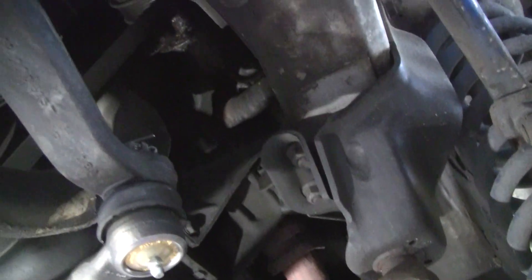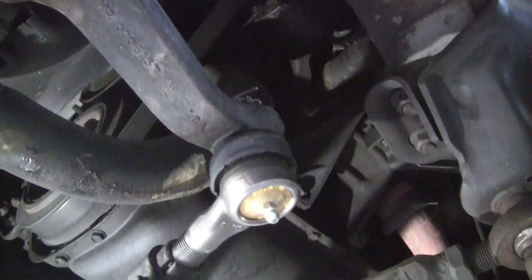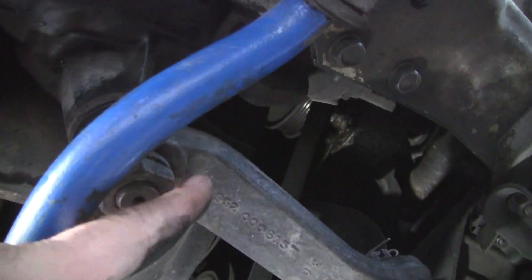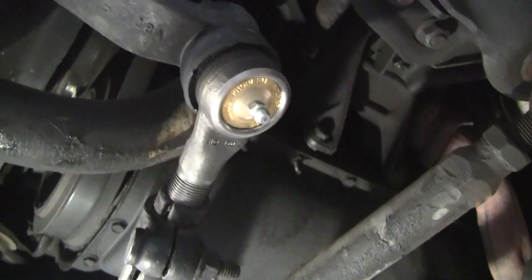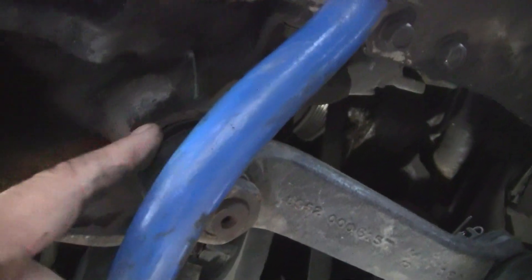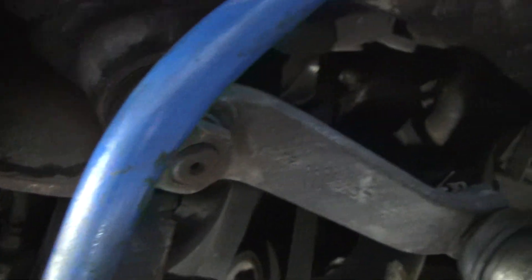That's it for this morning. I got out here at 5, it's now 6 a.m. Next thing I'm going to do is go up to the adjustment on the top of the steering gearbox and give it just maybe an eighth or a quarter of a turn tighter, because this was moving a little bit here just a tiny bit. But it all adds up.